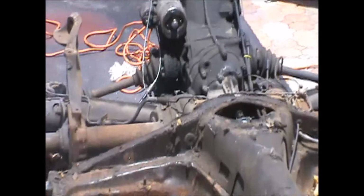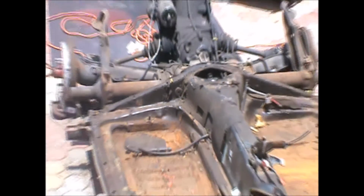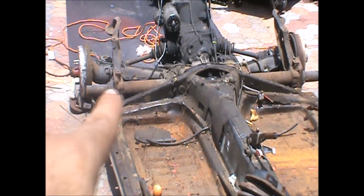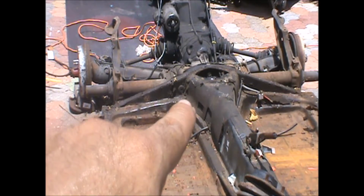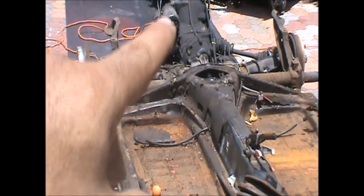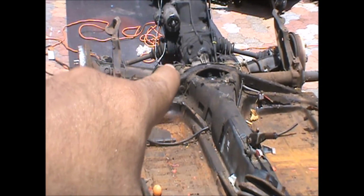And the other pot of gold that I'm going after is, let's see, we zoom out just a hair, that whole torsion, that's what holds the torsion inside of it. So what we're going to do is get that snipped right there. But inside of this tunnel, you got to watch out, you got a bunch of little tubes: throttle line, clutch line, e-brake. The e-brake cables run inside there and also in their tubes.